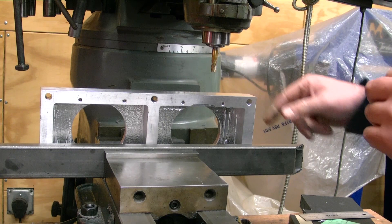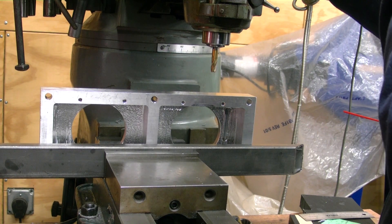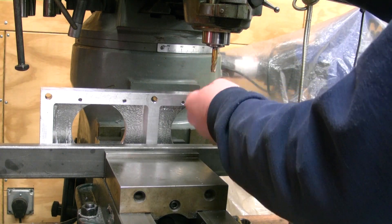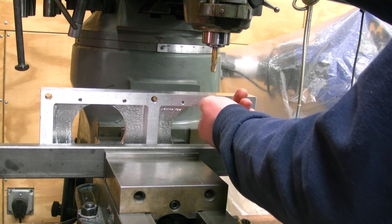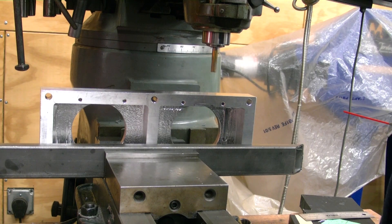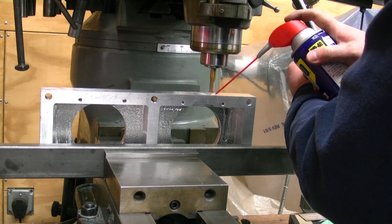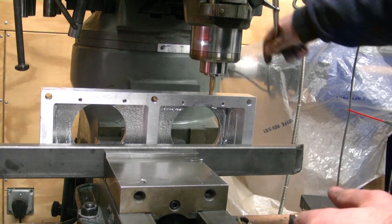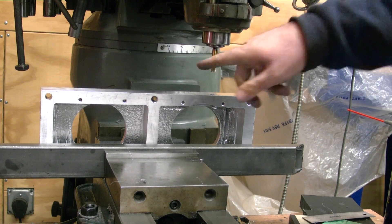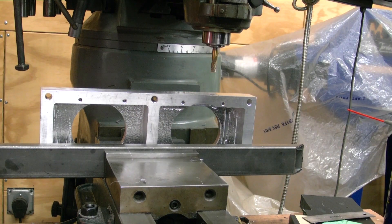To do these injector holes, I'll show you the steps I take — this will be very abbreviated but you'll get the hint. The first one I start off with is a 3/8 bit. That gives me the hole diameter needed to get the injector tip out into the chamber. I'll start by drilling that, then figure out the rest of my holes and get those all drilled out to make as few tool changes as possible.